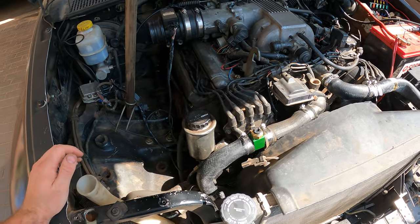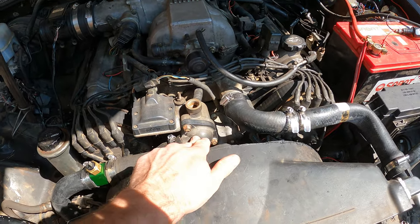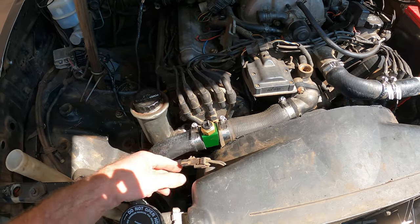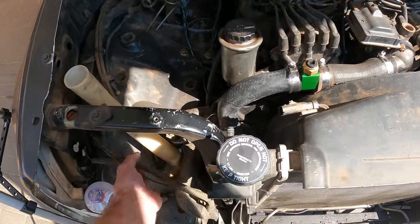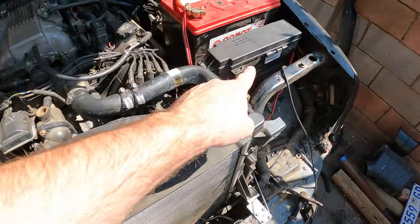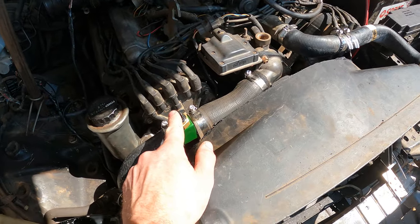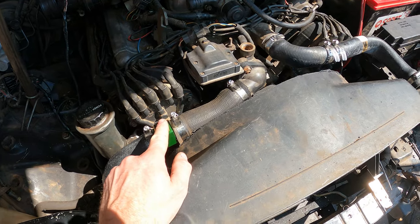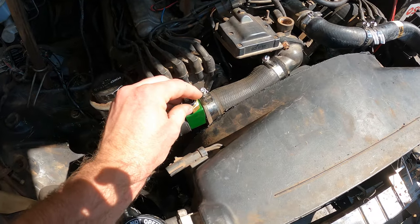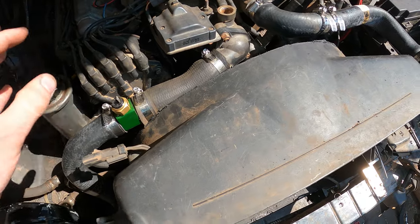Okay guys, I got a little bit carried away off camera there, and I finished installing all these radiator pipes, then my thermostat housing, all the way with my temperature switch, which will turn on my fan eventually. The plug is right here, and there's a little plug there. Tracing back these wires, they will be going back into the fuse box, hooking up to a relay, and then this will be just grounded down, and this ground will go to the relay switch, and once this gets hot, 95 degrees, it will say, hey, time to switch on the fan. Pretty easy, and that's done.